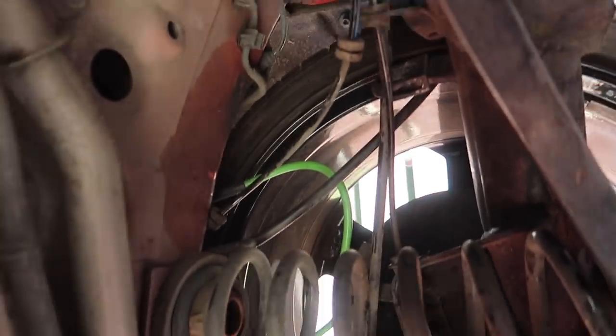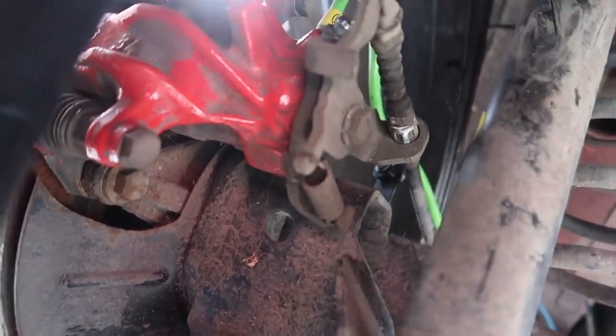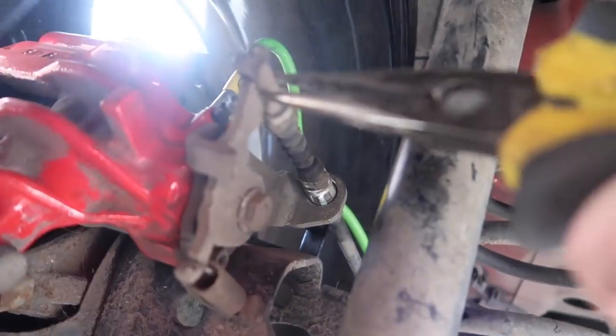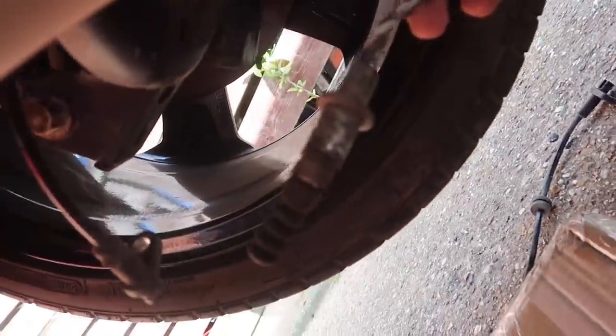This side's going to be a pain in my arse. I may have to take this wheel off just to get the ABS sensor up because it's cable-tied up and just to plug it in it's going to be a lot easier if I just take this wheel off - it's only four nuts. I've noticed - coming to take this off - it's pretty much going to have no slack in it because it's not even attached. Got them from up top, so now I've just unplugged it up there for this ABS sensor. One handbrake cable was out - that was when it was actually on. This one was cable-tied up because this is the one that got ripped out.